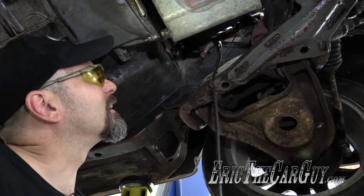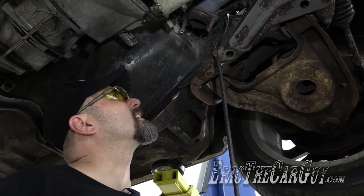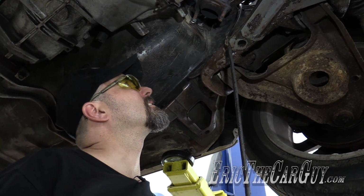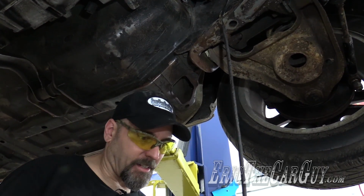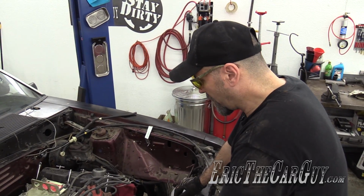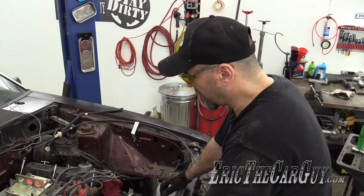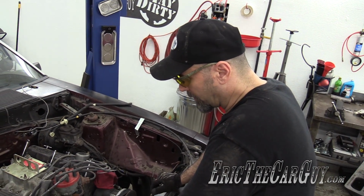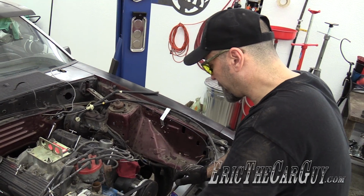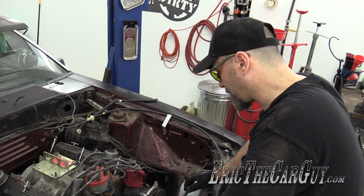It's not sliding out of there. We'll just be really careful when removing it because we don't need that steering shaft or anything. So we'll just do what we can to sneak past it. Heck with it. So what's next? Well, the power steering pump's really the only thing that's still connected, and that's not coming with. So we're just going to remove the belt, power steering pump, and see what happens.